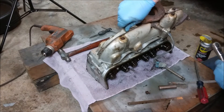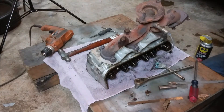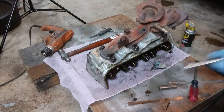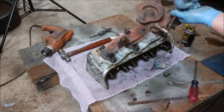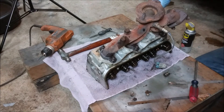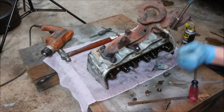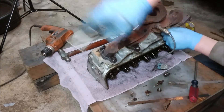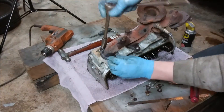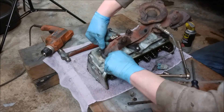It was just a series of 10mm bolts that hold the heat shield on. On one corner there's actually supposed to be another bolt that was missing — probably rattled out at some point. Just giving everything a quick soak to help break everything loose, and most of those studs pulled out. I'm still debating whether I'm going to separate the nut from the stud or just reassemble them as one piece. If I separate them out, clean them all up, and anti-seize everything, the next guy coming along will be able to take it apart and have a better experience.